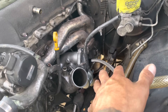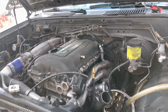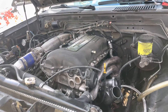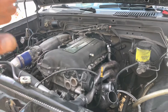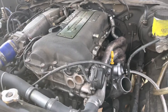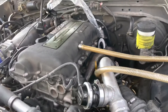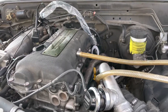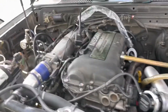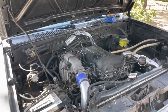Then we can see what our air-to-fuel mixture is and mechanically tune it from there. In this video I'm also going to be showing you how to get a little bit of power out of your SR20 — it's nothing crazy and no, it doesn't hurt your motor in any way, but it's to unlock the true power of a stock SR20 with stock ECU. Everything is pretty much back together — next on the list we're installing the boost controller, then welding in the bung. Everything went pretty smooth, got it done in about four hours.